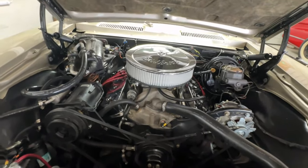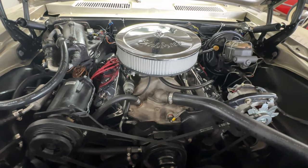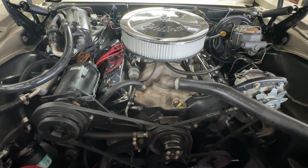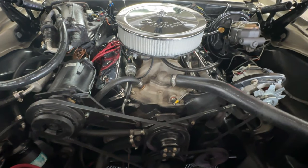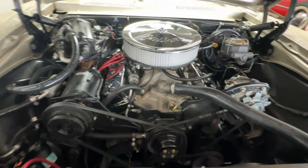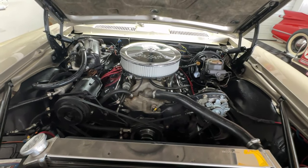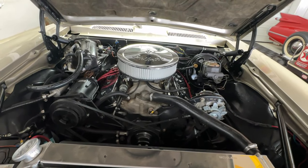There is a lot to love under the hood of this car. Mated to that 350 is a 700R4 — that's a four-speed automatic overdrive transmission — and it puts power down at the back wheels through a 10-bolt rear end with 3.73 Positraction gears. So with the automatic overdrive and those 3.73s, you can do a burnout or you can cruise at 80 miles an hour down the freeway and keep up with the fastest traffic — this car will do it all.